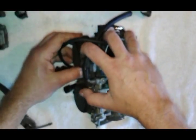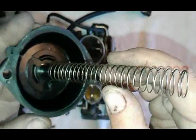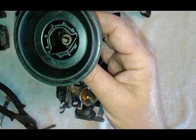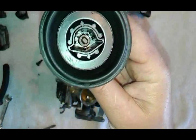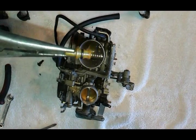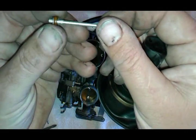Put that aside. Next thing, I'm going to turn the carburetor around and take the top covers off. Put your finger over the top of it - down here you have a spring that fits into the cover, and your needle that's held down by this retainer. If you ever need to change the needle or put a little spacer underneath it, this retainer will just come right off. Turn your needle upside down and voila, there it is.